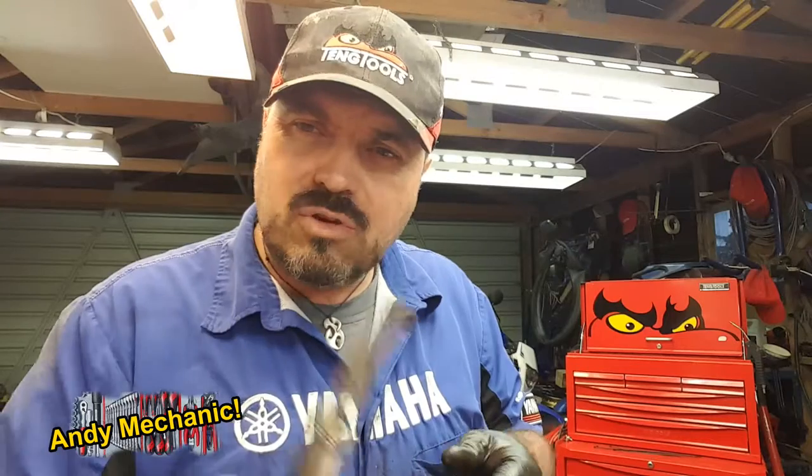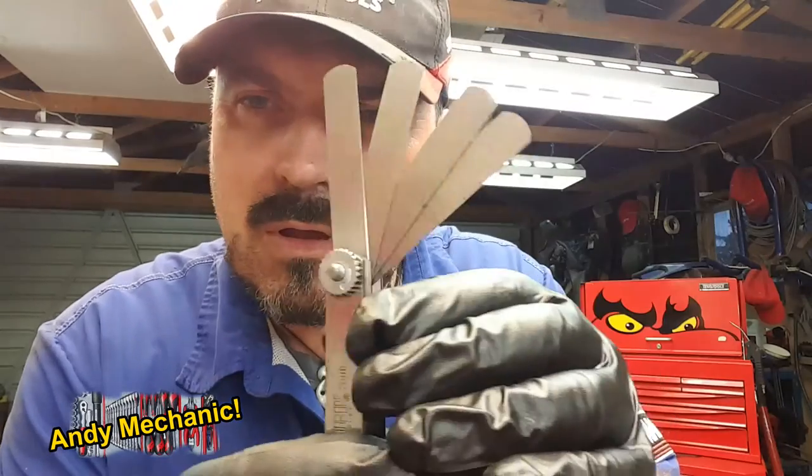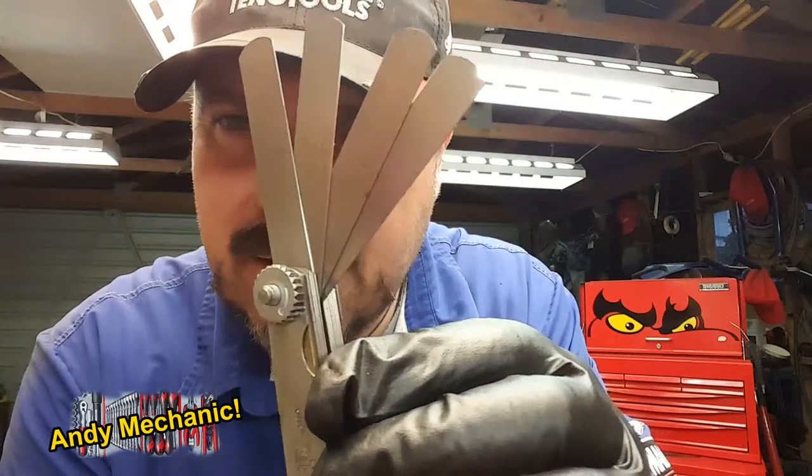You're going to need your hands to do other stuff, like use feeler gauges to measure that gap. So I've just grabbed a bunch of feeler gauges — I think there's four there — which pretty much make up the spec. The spec is two millimeters. So these springs can be two millimeters out of square and they're still okay to use, but anything more than that they need to be replaced.